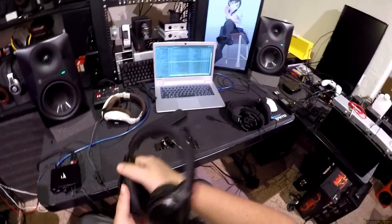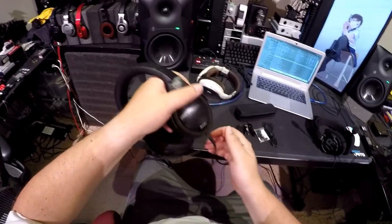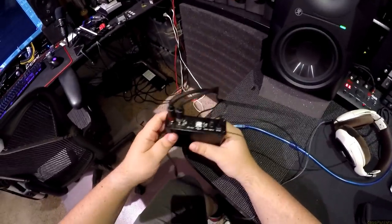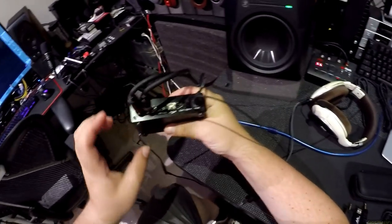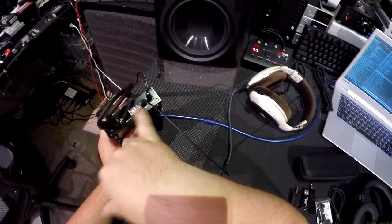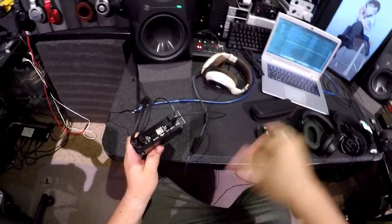We should look at the back of the unit. RBH HP2s, by the way — this works. Left and right RCA outputs — line outs — only work when you unplug the headphones. It's unfortunate. But same quality as the DAC internals. Here's your switch for USB or optical. Currently using optical, which you could use on a game console. Or if you don't want to deal with USB — because there are some issues where it's 24-bit 96 or 48 only — then you could use optical.